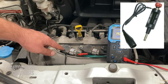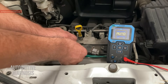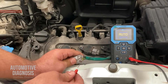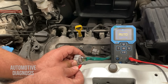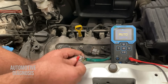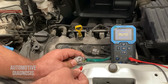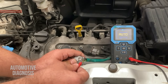For the wiring itself, we have three wires here. If I disconnect this connector, the black wire with yellow strips is the positive, the middle one is the negative, and the last one is the trigger. If you check the other connectors on this car, you'll see the first and second wires are exactly the same color, but the last wire — the trigger — comes in a different color because triggers have separate wires.